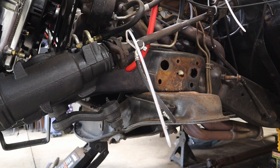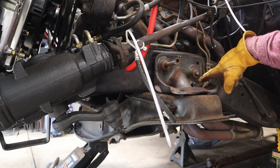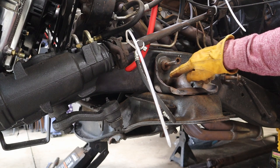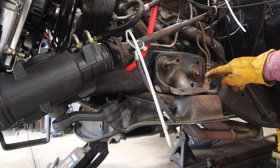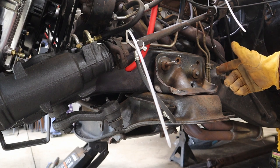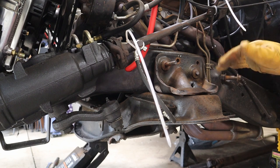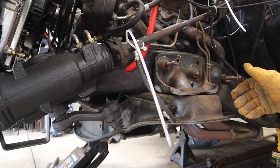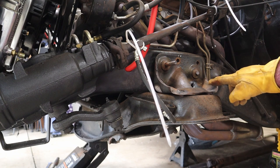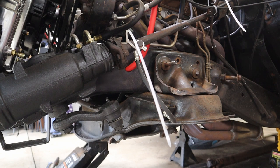The downside is on the back side of this perch, there are two welded in cage nuts, and the first one came out okay. The second one we could not get leverage to loosen it. One is we have our headers in, and the headers really restricted anything to be able to get within the frame and gain leverage. So fortunately for this side, I just took the torch and melted everything until I was able to beat it off with the hammer.